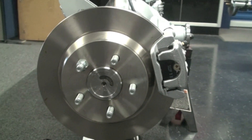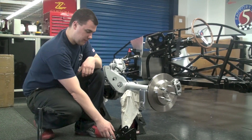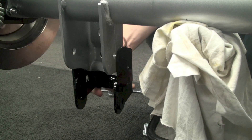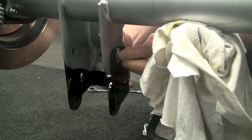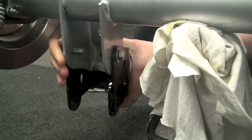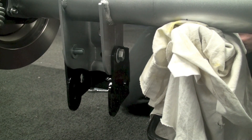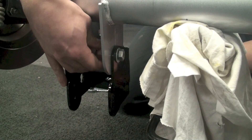With the brakes now installed we're going to go ahead and put our traction lock brackets into place. We'll grab the right and left hand sides, slide those over the factory lower control arm mounts, then go ahead, take our two bolts, slide them in from either side and tighten those up. We'll wait for now to put the rear one in as we need to have the rear end in place to put the shock through to tighten that down.